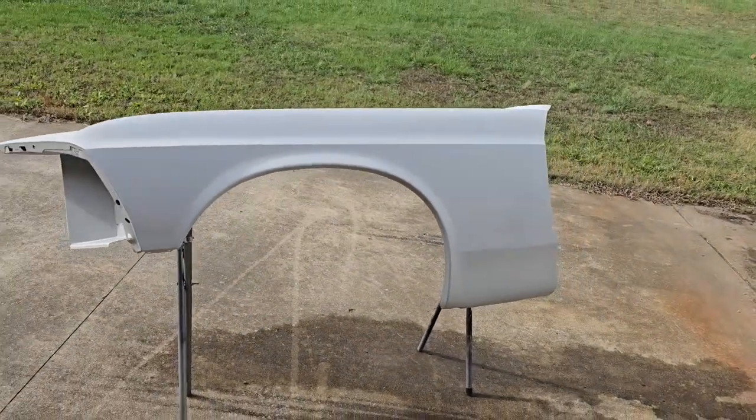So I'm just gonna let it sit out here and dry for a bit. That's a big no-no. If I would have epoxied over that rust, it would have come through eventually and messed up these new fenders. That sucks, but hey, we're getting there. We're getting things done. We've got a lot of stuff in the primer. We got a lot more to go.